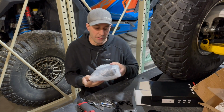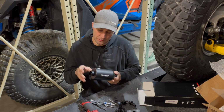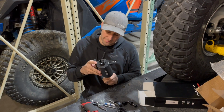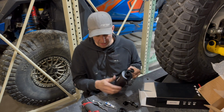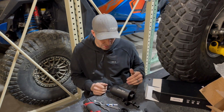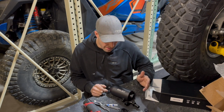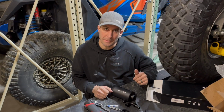And of course, your dual baffle RPM Catch Can. Anodized black. So you got dual baffles, bang, bang, intake port, drain port, and then a vent. So this is going to attach to the chassis. This will be on the back side, and then we'll use the supplied hardware. We'll Loctite them, secure it to the chassis. We'll go ahead and get what we can assemble on the Catch Can assembled. We'll do the filter and the drain, and then we will prep the Loctite on the bolts and get ready to take apart the car.